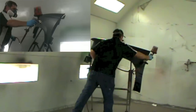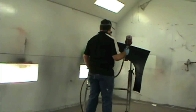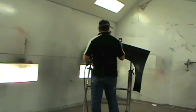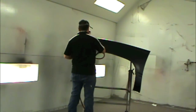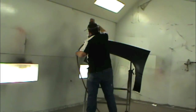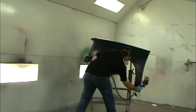Notice how far away the gun is. Since these coats are put on not too wet — you're putting them on pretty dry — it only takes a few seconds with the air gun and does not take long at all. As soon as it's dry, you can put another control coat on. Generally one to two is enough; I'm going to go ahead and put two control coats on this one just to assure all the metallic is laid out right so you don't have any mottling or striping. Now I'm putting another control coat just on the outside surface using the same technique — gun back about 12 to 15 inches, tight overlap, going fast with lower air pressure.